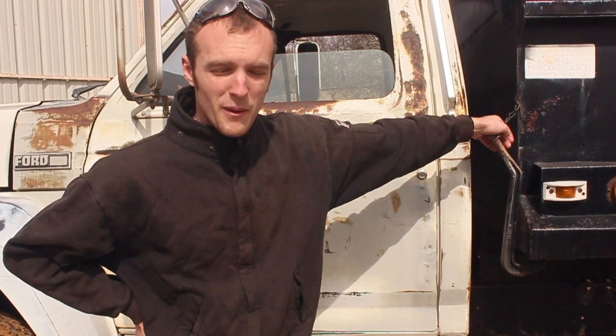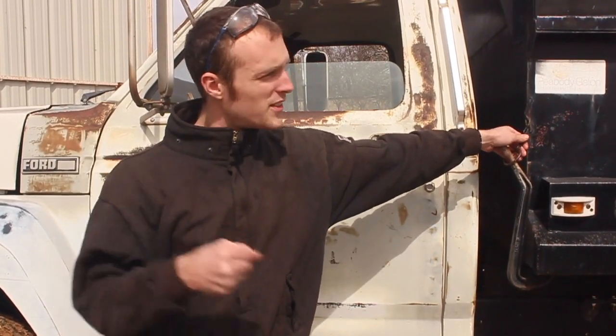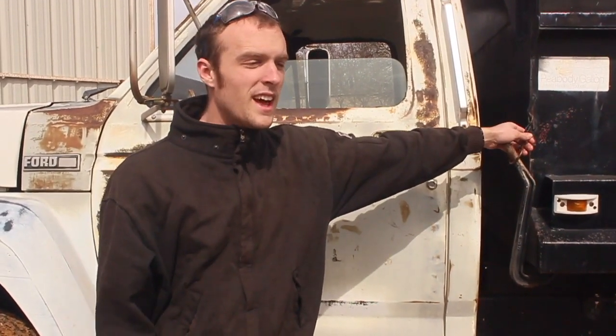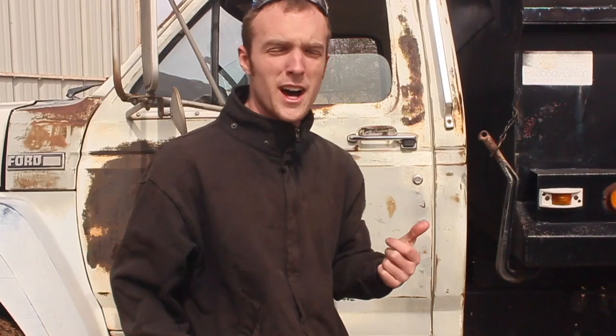One problem, however, is if you take the control lever for the dump bed and tell it to drop at full speed, it shoots a little bit of oil out the breather cap, because all the oil rushes in from the cylinder into the reservoir and creates a lot of turbulence, and a little bit splashes out the top. So there's two ways a person could avoid this if they were going to build a tank like that.